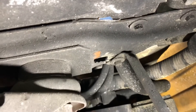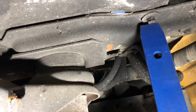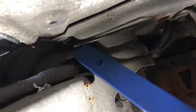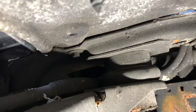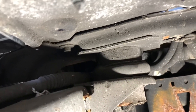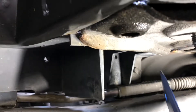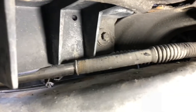This is underneath the car underneath where the battery goes, and the underside looks like this. So this is an 8mm bolt here that's going to come off and then over here right there is the other one, so that should then allow the battery metal tray to be released. Then underneath here there's one last bolt that you've got to get out - that's just an 8mm - and then I think the rest of this plastic piece should then come out.